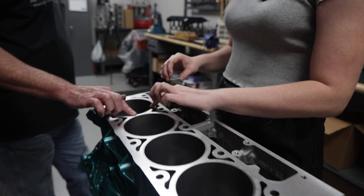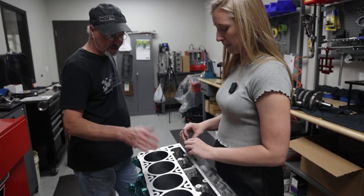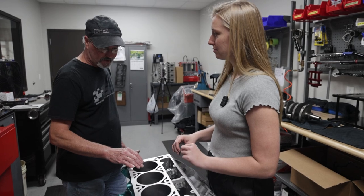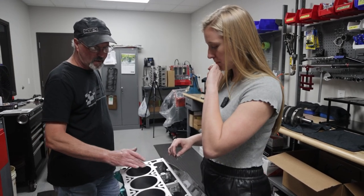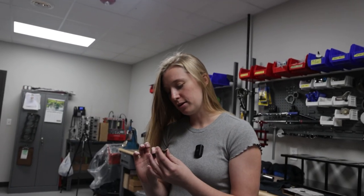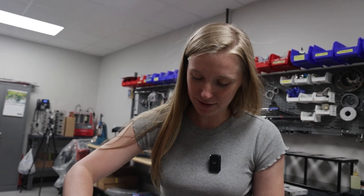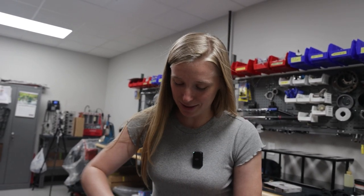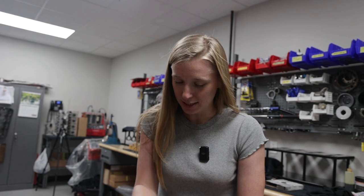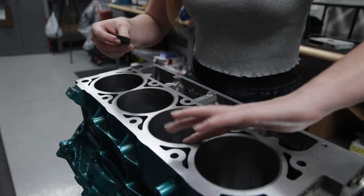Real high compression motors, they'll leave the sharp edge here because it helps build compression and all that kind of stuff. But I don't like it because if it grabs a hole in the ring and you don't know it, it's not good. So we have a little piece of sandpaper — 320 grit. Machinists love the really straight edges, but we're going to get rid of that because we don't want the rings to get caught. We just want the rough edges off.